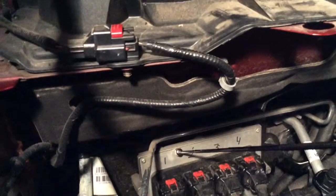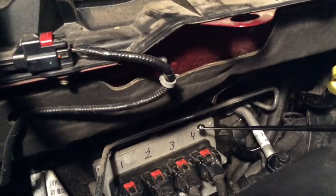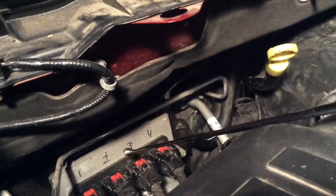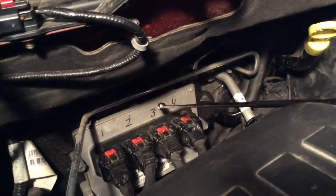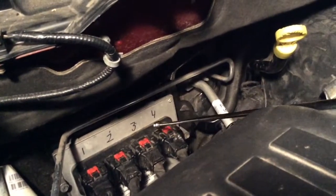When you're back here, you've got to number these — they are color-coded, at least on mine, but just number them just in case. Because you can't get that fourth one until you take these off — these are your ignition cables. It took us 30 minutes to figure out why the truck wasn't working; it was because these were not plugged in. So make sure you remember that.